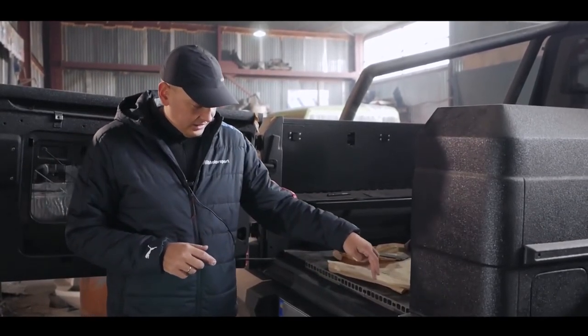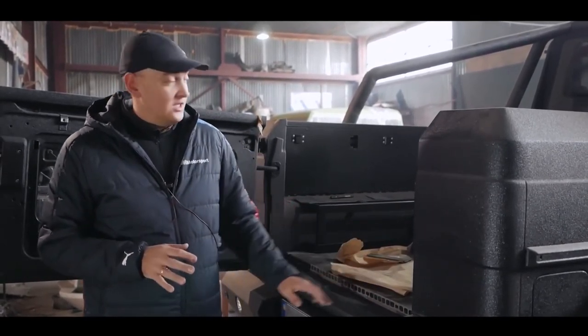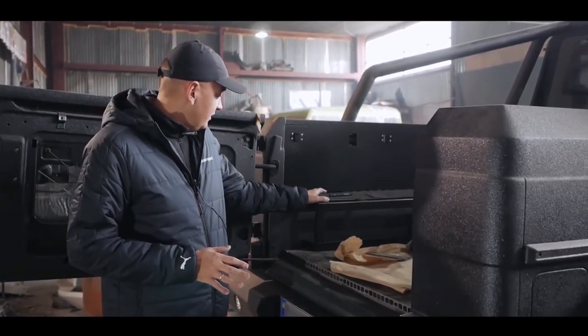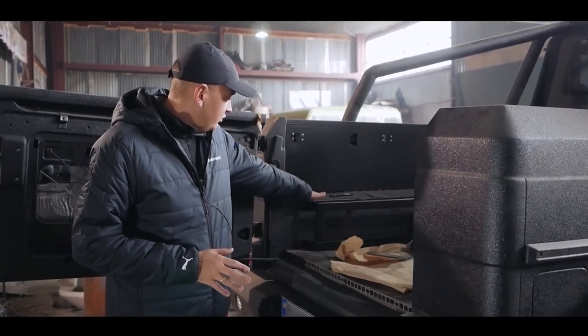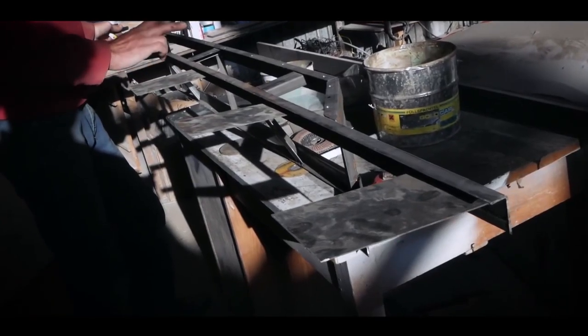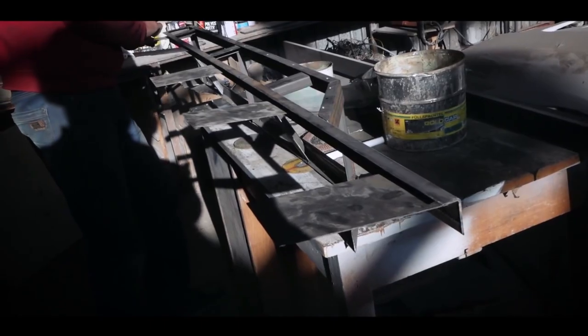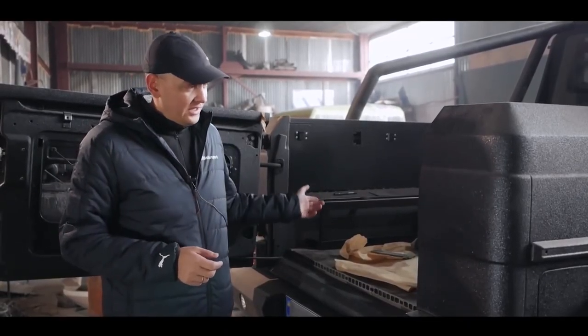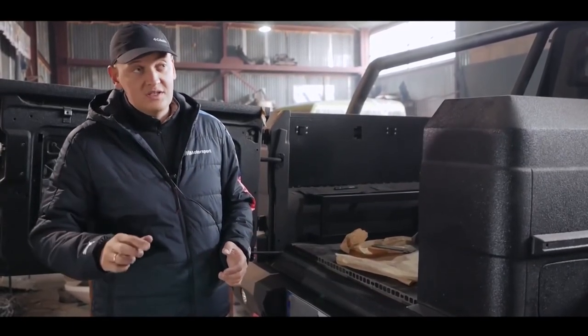Obviously, we'll paint the holes, cover them with grease and use aluminium rivets. Of course, little parts of the rivets will be noticeable at the bottom of the welding. We'll cover it with some sealing compound, so it will be unseen and protected. This construction had been sandblasted and painted with powder.